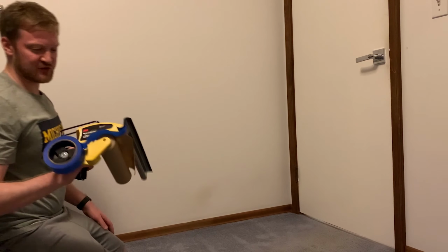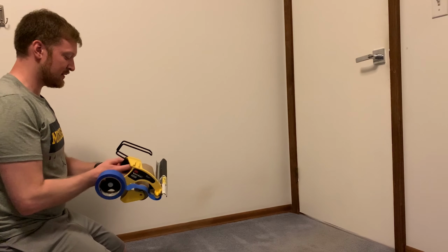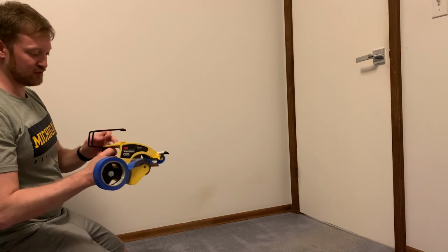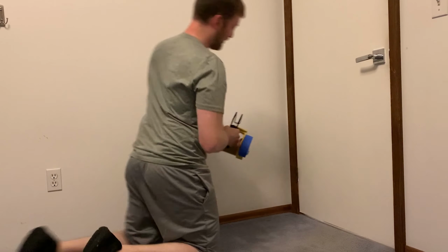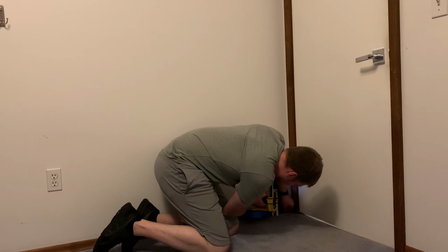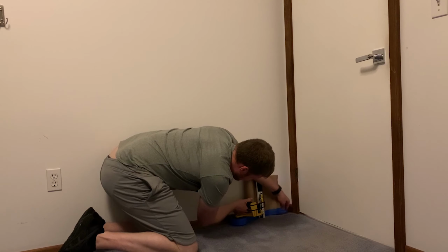As you can see here, I'm just going to use the 3M hand masker M3000. I'll try and put the link in the description. Got it on Amazon. It's a pretty great device. It connects the tape to the masking paper, and you just basically pull it out, start your edge, which is going to be the bottom of the molding here. Get it started a little bit, and then you just pull the handle. Kind of guide it with your other hand.